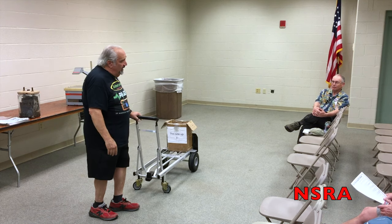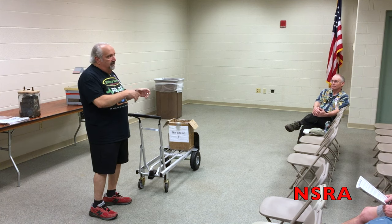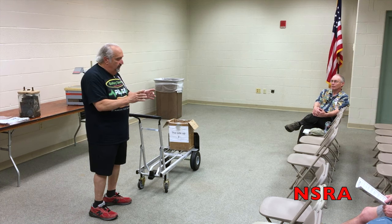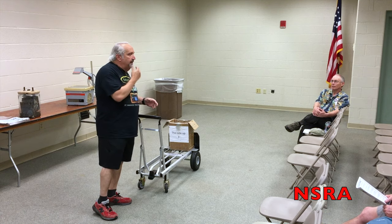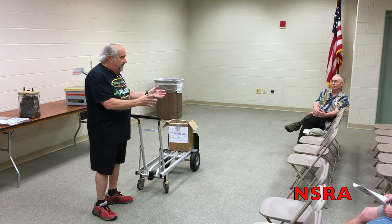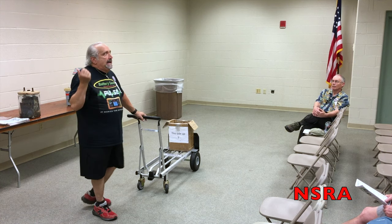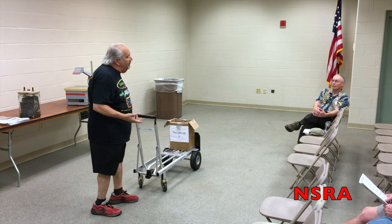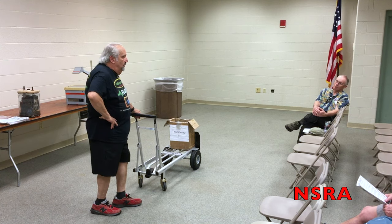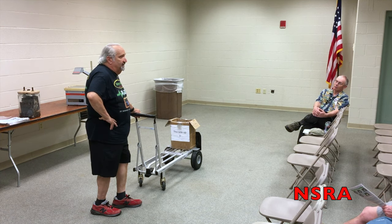What I tell people to do, and this is what I do when I've got a 6-volt car, I bought myself a spare Optima 6-volt battery. If you want to see what one looks like, I have one in the booth. It's awesome because it will run my car. It's half the size of a normal battery, puts out a ton of amps, and I can put it in the trunk. If I have a problem with a 6-volt car and the battery's really bad, I just take the other battery out, put this in, and bungee it in place because it's smaller than my normal battery. I can use a set of jumper cables with it and jump the other battery, and I'm never screwing around with anything higher that would hurt anything, including obviously the coil and the condenser. They don't want 12 volts.